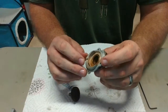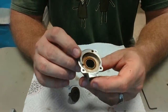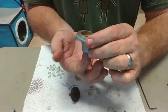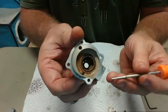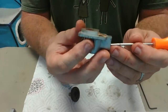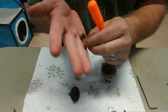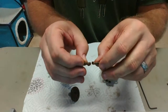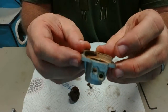You can see there's this area on these OS engines — it's kind of a bad area because not a lot of lubrication gets in there and they tend to get really nasty pretty easily. The engine doesn't have a lot of runtime on it but it's already pretty nasty in here. I think I'm going to end up having to invest in a set of bearings. These cam followers here — I think there's one for exhaust — last time I took one of these apart it was kind of a pain. You push those things out and they're hard to get back in. Looks like there's a difference between the two — too late now because I've got them mixed up.